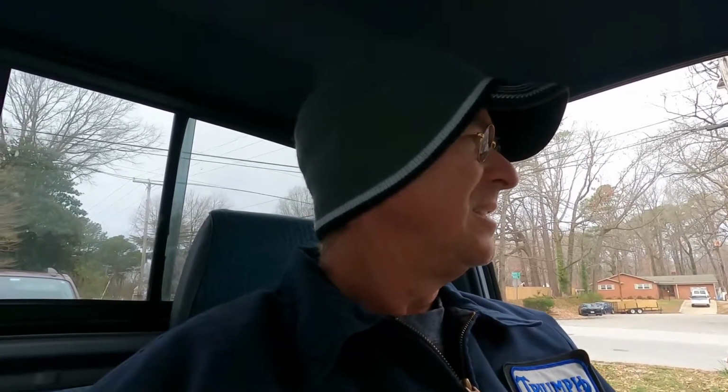I came home last night, got on YouTube and looked up a few things that cause those problems. One is the EGR valve. Well, they have a tendency to get really clogged up on these trucks, especially on the 22R's and 22RE's. I pulled the EGR off, and let me tell you how much fun that is, with the engine being in the truck, woo! Really pushed my buttons on whether or not I'll ever own another Toyota.